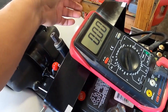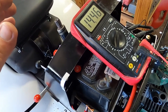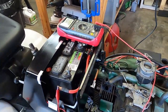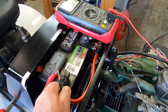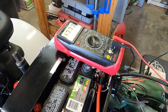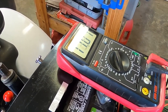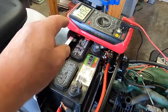Key off, key on. The next step is to hook it to the battery. Everything was correct in the beginning except I had a five-amp fuse. If I turn the power on I've got 14 volts. If I just tap this, the battery loads it down and I got a spark, but now it's charging the battery — we're up to 15 volts. Yeah, it was the initial jump to the battery that blew that fuse.